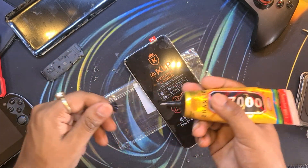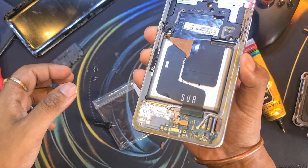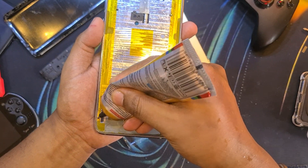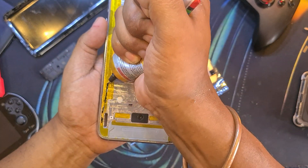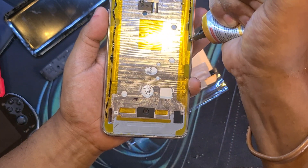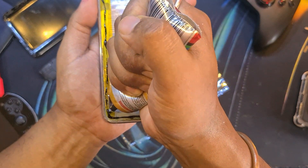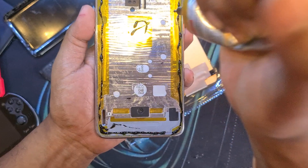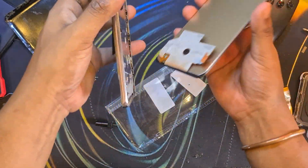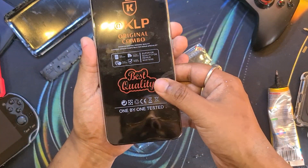I'll be gluing it down with T7000 LCD glue, which I bought years ago and it is still going strong — very cheap and very effective. I like to apply a very thin bead of glue, not too much, because in the near future if we again have to change the display or that part — specially for batteries and displays — you just won't be able to open it even with a lot of heat. So I go for a minimum amount, just enough to hold it together, and it does the work quite fine.